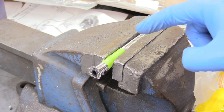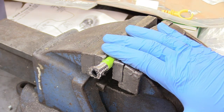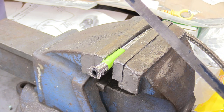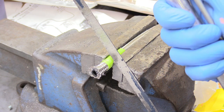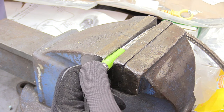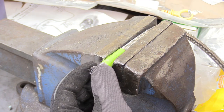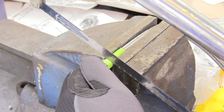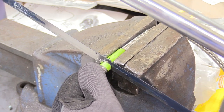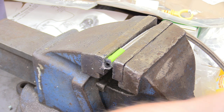I have the AN line already in my vise and wrapped very tightly with 3M Scotch tape — three or four times around. Now grab a hacksaw or some electronic implement that makes a nice clean cut. The main thing is to keep it against the side of the vise so you get a nice square cut. Support it with your other hand — it's a good idea to wear thick gloves because the braid will poke you pretty good. Once cut, clean up the braid with snippers.